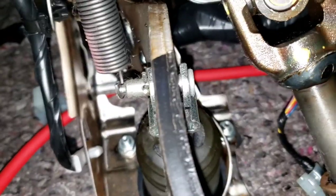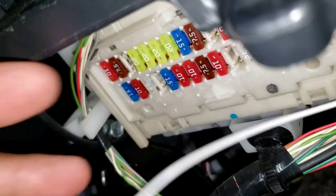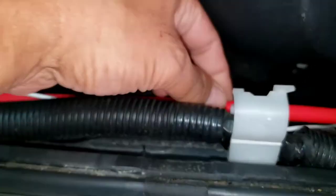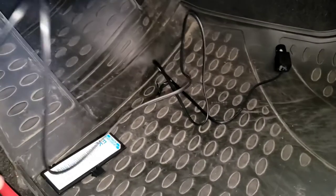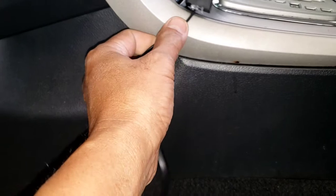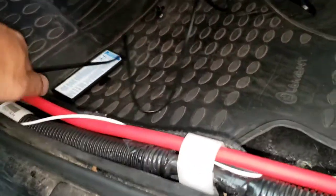So what we've got right now: the power wire ran along the top, then straight down here. We're leaving the remote wire right here and we're gonna hook it up to the fuse box down here — we'll show you which fuse you need to hook up to. We're gonna pop this open, put the four-gauge wire in, put it back, and we also have to hook up the bass knob controller. We'll leave it long enough — the customer said about right there — we don't want to screw anything to their car until they approve it.